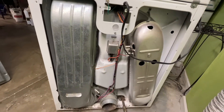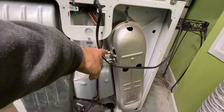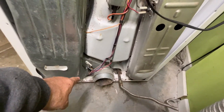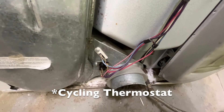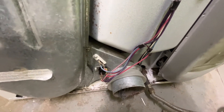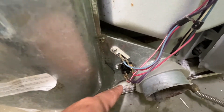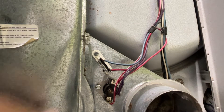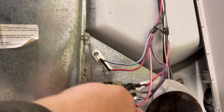Once you have your back panel off, this is what you see — you have a bunch of different switches in here. These are high and low limit switches. You've got your thermal fuse down here. And down here this is the continuity fuse, and that's the one that we want to test out. It's very simple to remove — you've got one screw holding it in and there are four wires going into it. Taking out that screw and then disconnecting the wires.